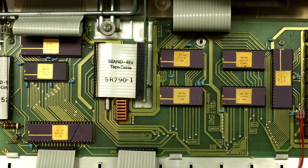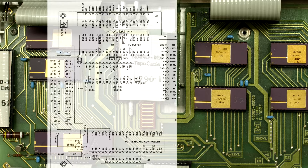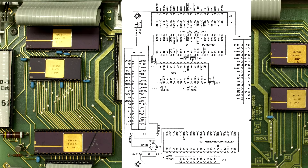If we look at the main processor board on the left-hand side, we'll find our main CPU. Using the overlay from the service manual — the chip up top is the IO buffer, which is right next to the ribbon cable going off to the expansion header on the back. Below that is the CPU itself in a 28-pin DIP. There's basically no glue logic because they did custom ASICs — any necessary glue logic was built into the architecture. The bottom chip, going to the keyboard ribbon, is the keyboard controller.